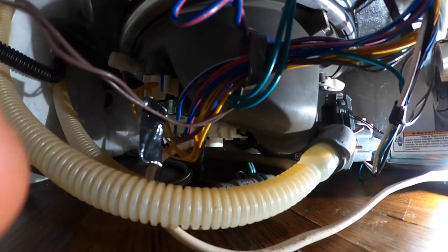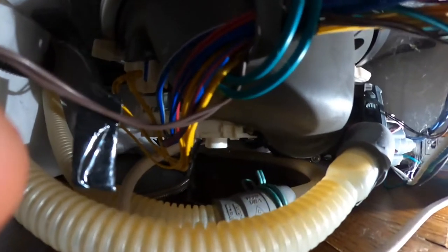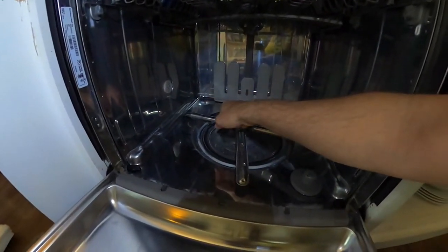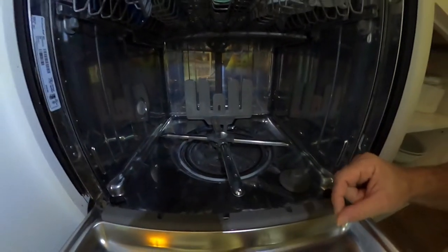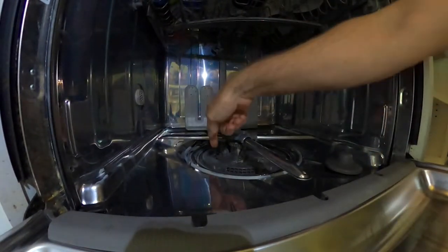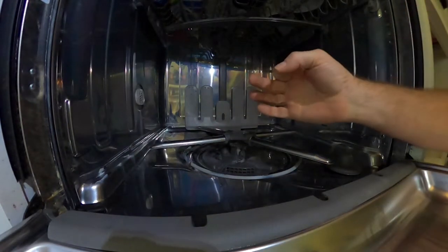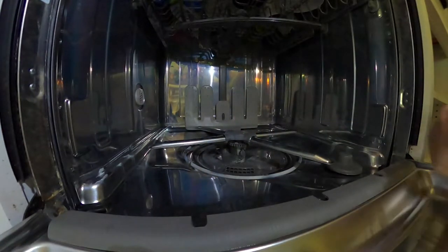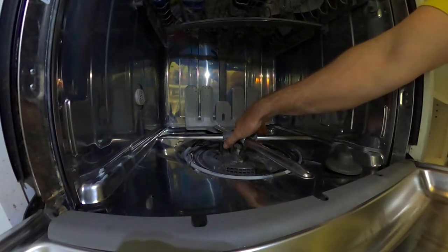So I gotta see why. See? Look at that. Definitely my culprit. Now to see why and how to fix it. So the part that's leaking in the center underneath, I found out is the diverter valve motor. And apparently the part that comes into where there's water is in here, under here. And it's got a little seal with a little pole or post sticking up through the seal. And apparently that little seal gets compromised after a while.